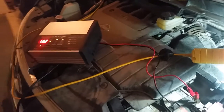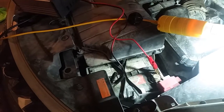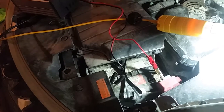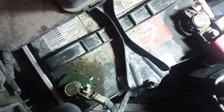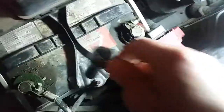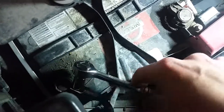Once the battery is fully charged, we're just gonna disconnect it and then try to determine if there's any draw on the battery when it's not in use. We're gonna disconnect the negative terminal. I always recommend using the negative terminal because the negative side is actually grounded to the frame of the car. If we tried to disconnect the positive side first and we hit the wrench on any part of the frame, we'd actually get a shock. Disconnecting the negative terminal means if we hit the frame it's already connected to ground, so it won't give you any shock.